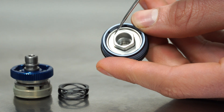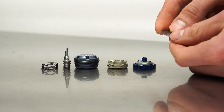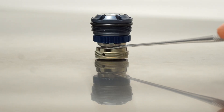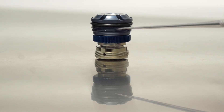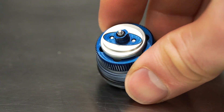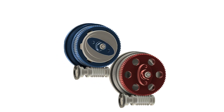But it gets even better from here, because the Tellum is packed with lots of little refinements. In the last video we talked about how different high-speed adjusters work. In the Tellum, we use a more advanced version of a typical preload-type high-speed adjuster, which doesn't preload the very outside of the shim stack, but instead preloads a part of the shim stack somewhere between the outer diameter and the clamp diameter of the shim. This allows the edges of the shim to flex up very slightly before needing to overcome the preload force, providing a softer transition between the low and high-speed portions of the curve. This reduces digression and allows the adjuster to have a larger impact on the high-speed portion of the curve while maintaining a lower impact on the low-speed portion. Additionally, the profile of the high-speed preload spool is elliptical, like the variable clamp system — this allows it to automatically track the setting of the variable clamp system, simultaneously calibrating your high-speed compression adjuster's range to be appropriate for the valving specification you're set to.